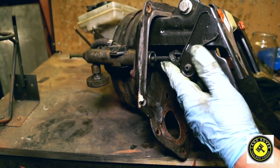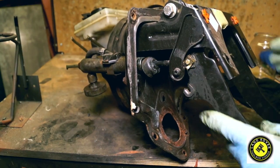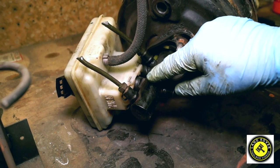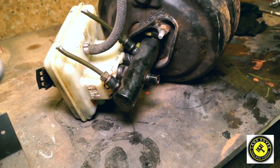Getting back to this one — somebody put some rubber grease in there a while ago, so it has been overhauled before. I'm going to have to pop the clip out and get this done. You can also overhaul master cylinders and replace the rubbers where the reservoirs fit in if you get the right kit. So this is just a little bit of an insight for you.